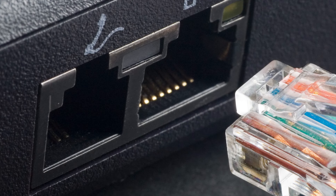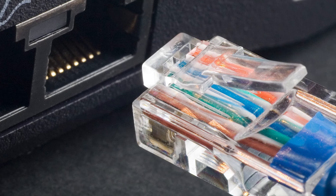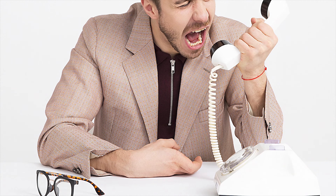As for tip number two, if you're looking at buying a Wi-Fi extender with Ethernet ports, then make sure that the Wi-Fi extender not only has enough Ethernet ports, but that the Ethernet ports are the right type. You don't want the Ethernet ports to limit your connection. For example, if you have 50 Mbps internet but the Ethernet port on the Wi-Fi extender is LAN 10 or 10 Mbps, then you will never get any faster than 10 Mbps from that. However, this is much less of an issue nowadays with pretty much all Wi-Fi extenders coming with a LAN 100 port or a 100 Mbps Ethernet connection.